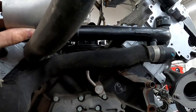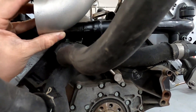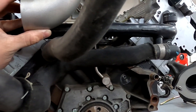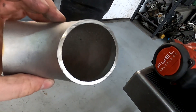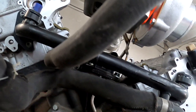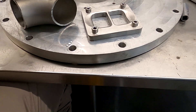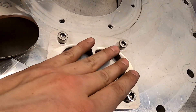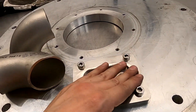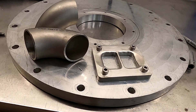The manifold is going completely flat using the coolant rail as a reference, and it's coming along great. I'm going to start by shaping the T4 flange — I'll make an outline of the outside of the pipe and bevel it out with the die grinder. I got the flange fully shaped as well as these pieces, so it's all smooth. It should help a little bit with flow — just beveled out and smoothed so it's not just a straight piece of flat flange.